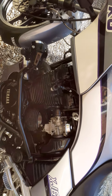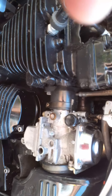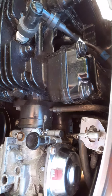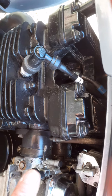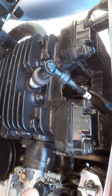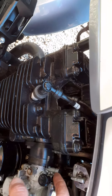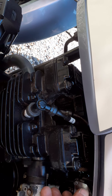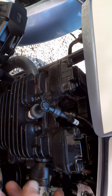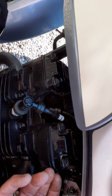With it being a 30-year-old bike, the main thing to know is the choke — choke all the way out when she's cold, and then obviously you want to reduce it. But as soon as you reduce it, it starts pulling itself all the way in, so I usually put a clothes peg in there. For the fuel tap, that's off to the front, and on is at the back.